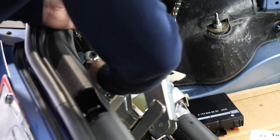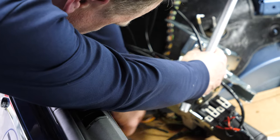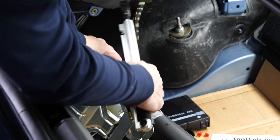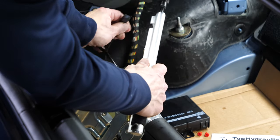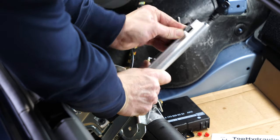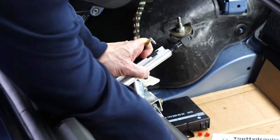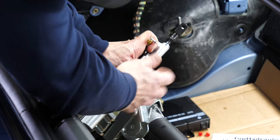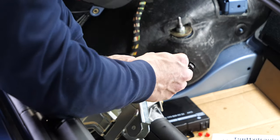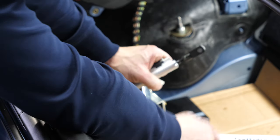Next I should put on the travel sensor because it will otherwise be obstructed by the hose. The travel sensor clicks into the cylinder's rail — there you go. Then hose number 33 goes on top. Put in the O-ring, gently put the fitting into the cylinder, and secure the hose with a clip — clicked into place.